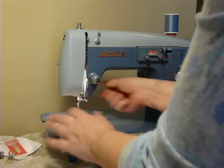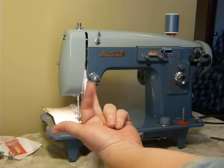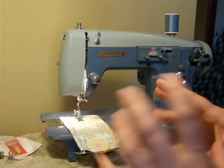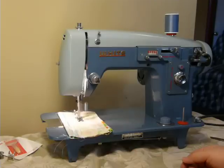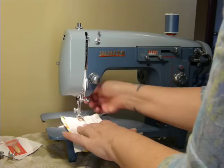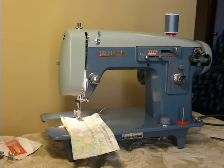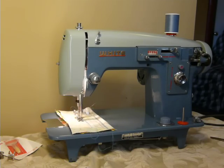The cords are in good shape. The machine has its own cords — a light plug and a motor plug — so if the foot pedal goes bad, you don't have to trash the machine. It takes a standard two-plug receptacle foot pedal, which is easy and pretty inexpensive to replace. What's nice about these vintage machines is you don't have to buy a proprietary cord. Electronic machines always have funky pins, and a power cord for your machine might cost forty or fifty dollars — but with these vintage machines that doesn't happen. You can always find a universal power cord.